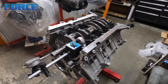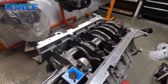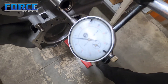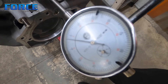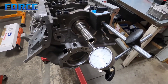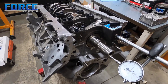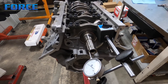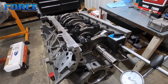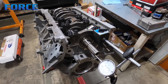Now that I've got the crankshaft in and torqued with the rear main — which on this one is the thrust bearing — I've got that un-torqued and my dial indicator set up. It's moving three thou right now without a pry bar or hammer. Because this is a floating bearing on the block side, we only push the crankshaft in one direction when setting the thrust. If you move it both directions you're not accomplishing anything and may move the thrust surface the wrong way. So you've got to make sure you push the crankshaft forward every time.